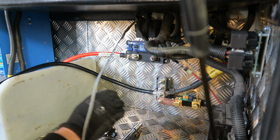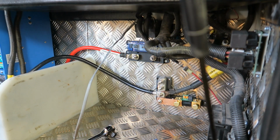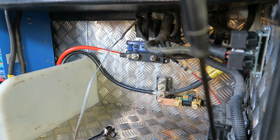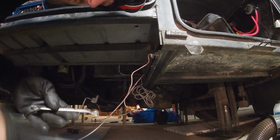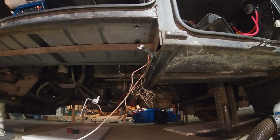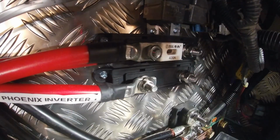We use the color controller. To connect this Phoenix inverter, we use the VE Direct communications port. I chose to buy a VE Direct to USB cable, and then I run a USB extension cable all the way through the RV and up to the color control. This gives us the ability to control the Phoenix inverter from the color controller, which has worked great.